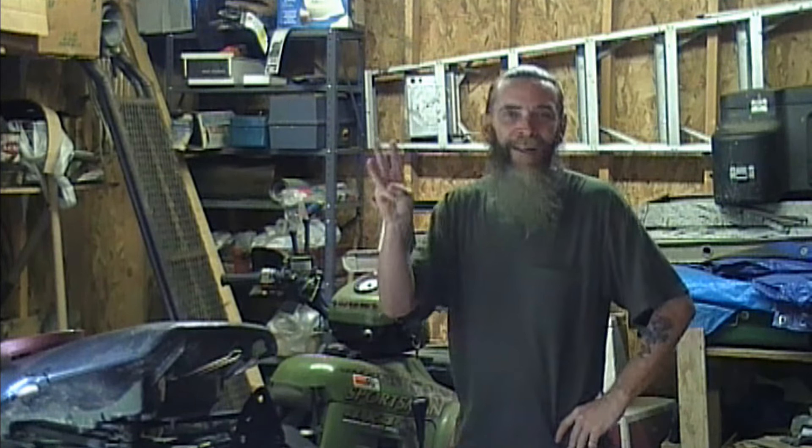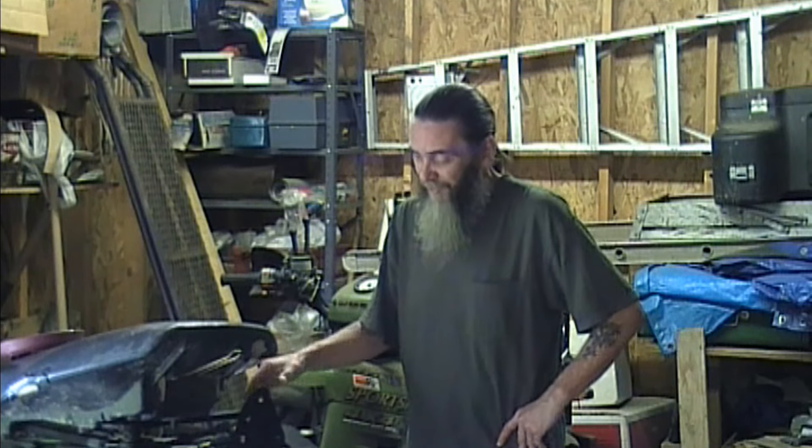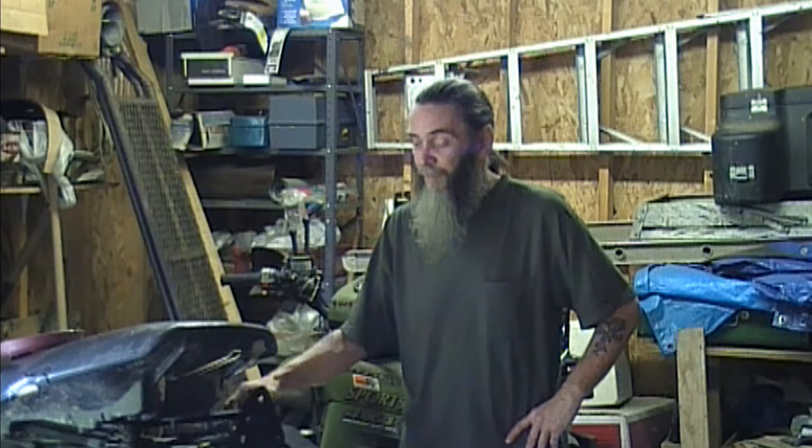Alright folks, welcome back to day 3. This is a big day. I've been letting that battery charge — it's been charging 24 hours right now, and I think that's going to be enough for that little battery. A bigger battery or a deep cell battery, you'd want to charge 36 to 48 hours on a trickle charge. We're going to look and see if all 6 cells are bubbling — that's a good sign, it means every cell is taking charge. I've had very few of them fail, but who knows — we're going to find out.